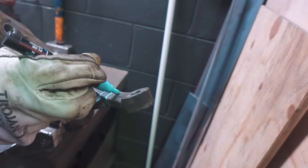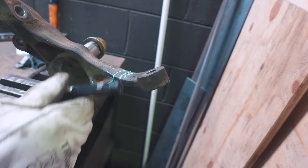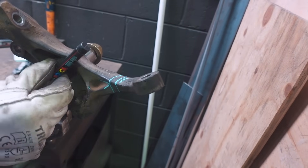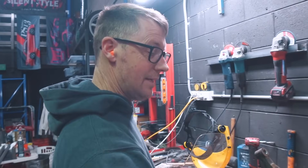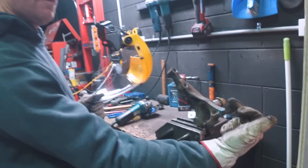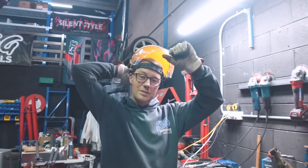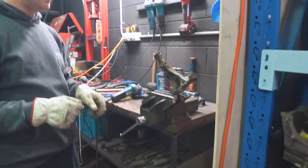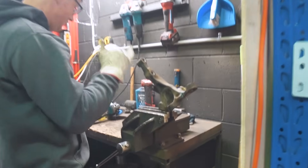You flatten off this little raised bit just here. Then you take that piece, put it under here, and move it out so it's almost in a straight line with the plane that this is on. And you rotate — the rotation is about five degrees less, otherwise your tie rod will bind. We don't want any bind. After that it should be sick — this thing's gonna steer sick, give us mad flicks.